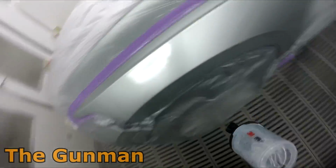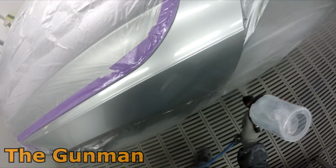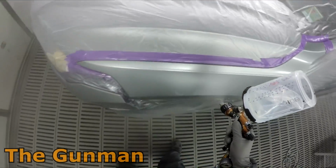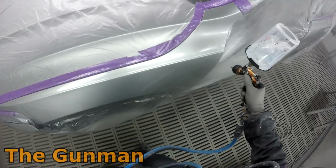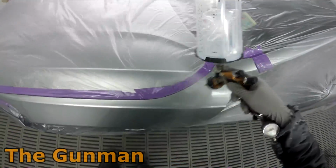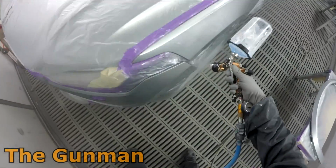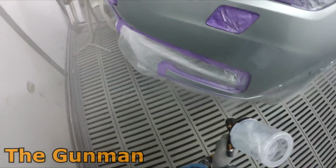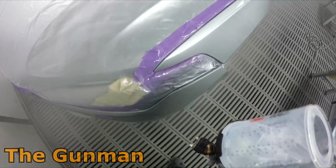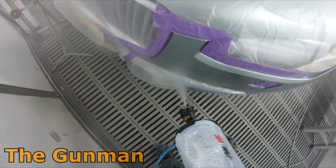That was over 10 years ago now, but he just came in and I was like a fish to water. He told me a couple of key points, and bang, my finishes improved immensely with HVLP. The main thing was distance. I was probably holding the gun back a little too far, and the second thing was pressure. I probably had the pressure a little too low, because when I was new to HVLP, I thought, LP, like low pressure. But prior to getting that guy to give me a hand, I was just winging it. I didn't even have a gauge on my gun.